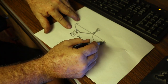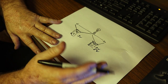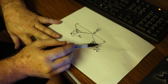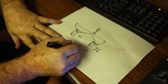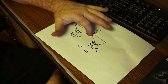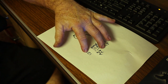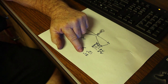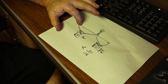This also works on the ground side. Hook your meter up to ground — it may show three or five volts, whatever the voltage drop is. If you hook the positive of your meter to the ground and the negative of your meter to the chassis and it reads any voltage, what you'd want to see is less than 0.01 volts on a good circuit. If it shows anything above that, it's probably not a concern until it gets to around 0.1 volts — at that point you're starting to get a sketchy connection, something to do with a dirty or corroded ground or connector.